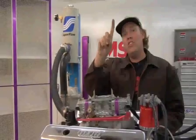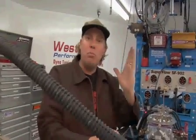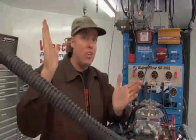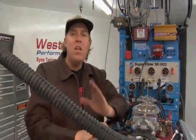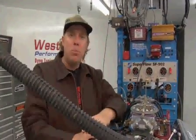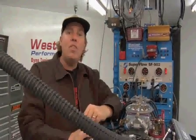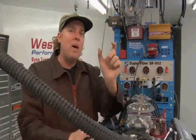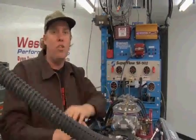There's an ignition timing curve between initial timing, which is a lower number, and total timing, which is a higher number. But why does ignition timing need to advance as engine speed increases? We always want peak combustion pressure to happen at the same point in piston travel — say about 10 degrees after top dead center on the power stroke. If there's a fixed amount of time between when the spark plug fires and when peak pressure occurs, then as engine RPM increases, you need to ignite the spark sooner so peak combustion happens at the same place regardless of engine speed.